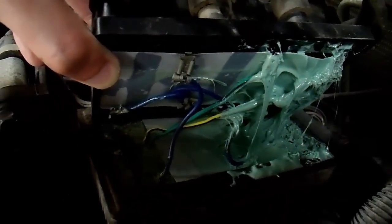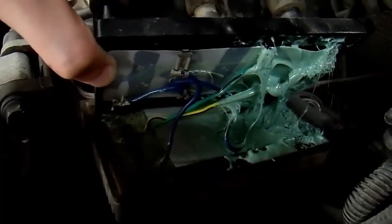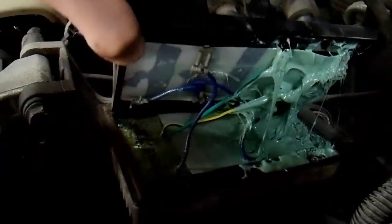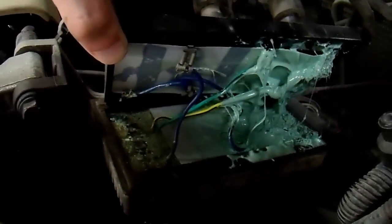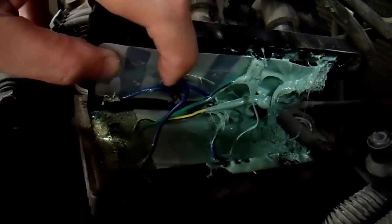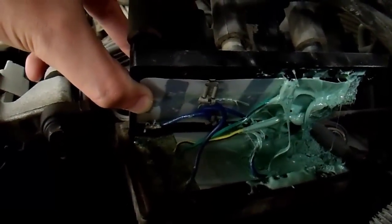The best thing to do here would be to just go to the junkyard and replace this entire assembly, like I said earlier. However, I think I'm just going to re-crimp this, clear out all the corrosion, and reassemble it and hope that it works. I'll just drive it locally for the next few months until winter, and by then I should have enough confidence to take it anywhere I want again. In this case, it was just a bad connection on the low voltage side between the coil and the ignition module. You can see all the goo flowed to the bottom — there's no goo left on top. There was no environmental protection left, so these corroded and got loose over time and no longer worked properly. It would rattle around every once in a while and make a connection again, which is what happened after I started the vehicle. This last time, they were finally corroded enough that they no longer did.